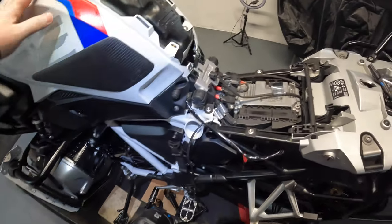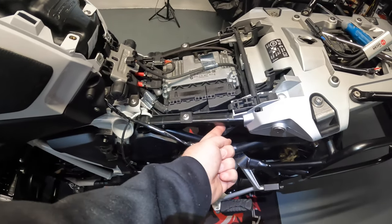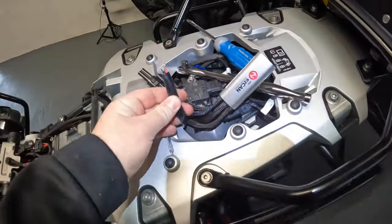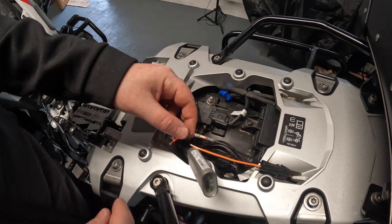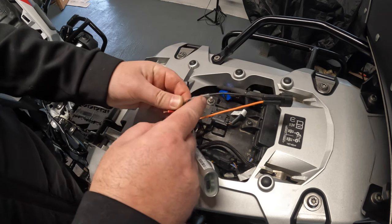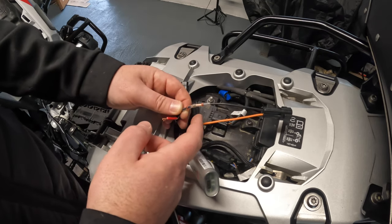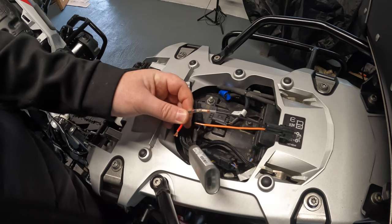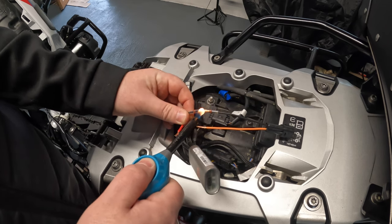To give you an idea what the wire looks like after we brought it up through the tank — I'm going to leave it on the outside here of the seat, run it under here with a couple of cable ties to make it nice and neat. I've threaded it up under here and I have a good bit of flexibility. Now we're ready to connect into the Hex Easy Cam. You get these connections with the device — two negative wires — I'm just going to splice them together using one of these heat shrink tubes that already has soft solder inside.